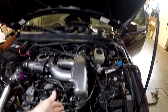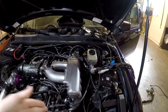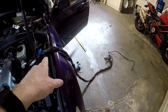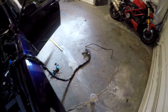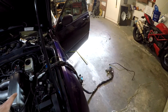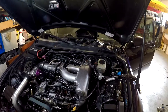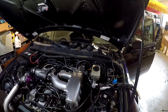With full access, I cut open all of it and fed all the wires back, over, down, and extended each one. Each section of wire I extended going out that way is at least six feet long — some a little longer, some a little shorter, but on average six feet. That's the O2 sensor there wrapped in foil — I'll explain that in a second. The main goal was to get that wire loom out of the way so it wasn't going around the front of my throttle body.